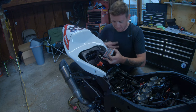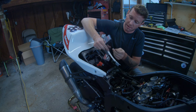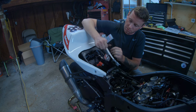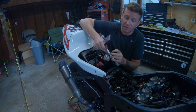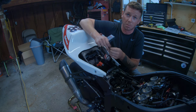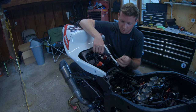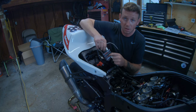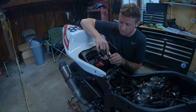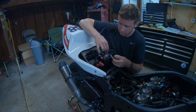The reason we need this is because we have an electronic sensor on our shift linkage that allows us to cut the ignition momentarily, and you can shift without the clutch and shift wide open throttle, so it really speeds that process up. We have our two wires coming from our shift linkage down here, and we're going to plug them into the ignition module into these little ports here. So we're going to go ahead and do that first.